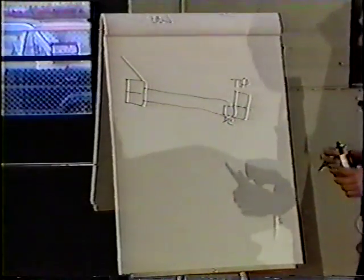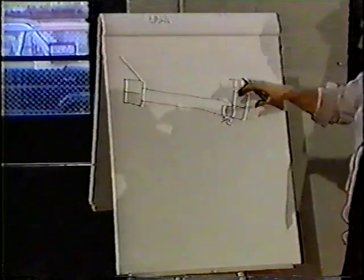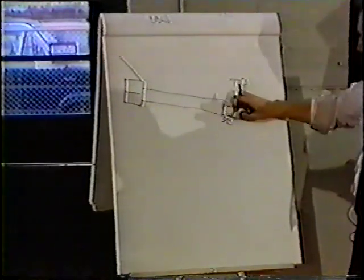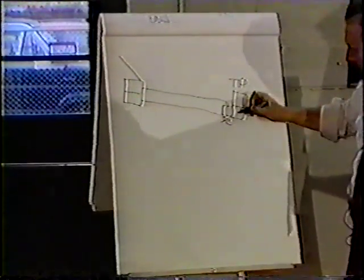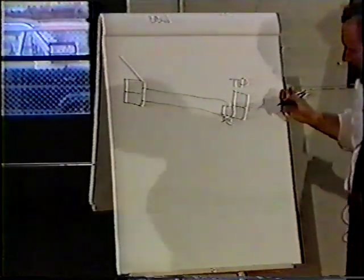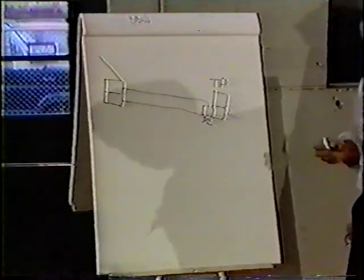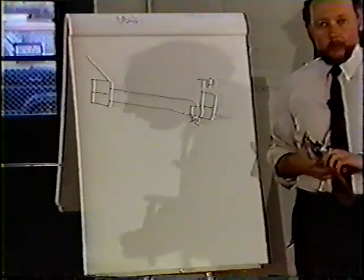That enters our double check. Providing the PP7 has been activated and it's sent pressure through the tractor protection, this is open. The higher of these two pressures is delivered into the tractor protection service section, and that air, whatever it might be, is delivered on to the relay valve of the trailer.